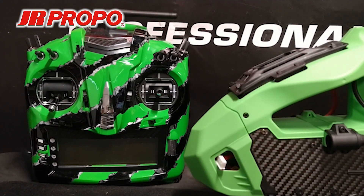In this video we're finally going to begin the physical setup of a helicopter with the TAGS Mini. We're going to set the reversing switches and swash mixing in the transmitter so that the servos all move in the correct directions, and perform the initial installation of the servo arms.